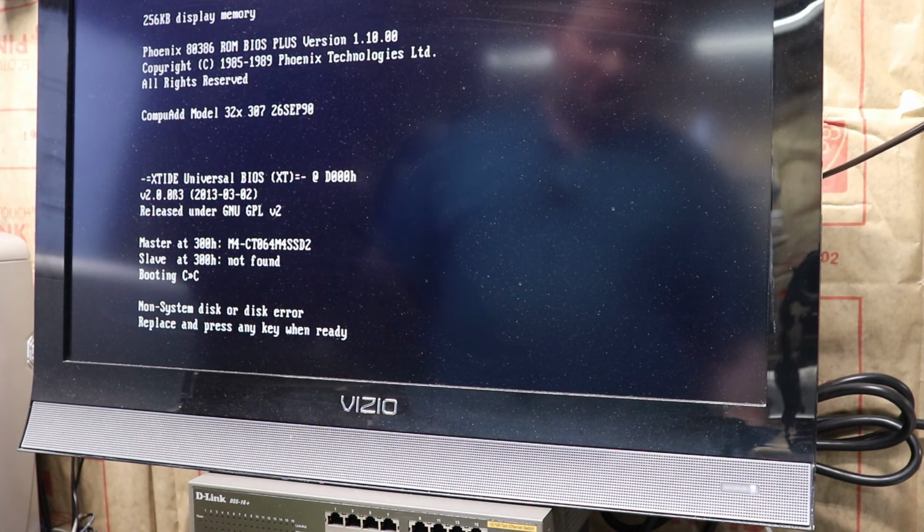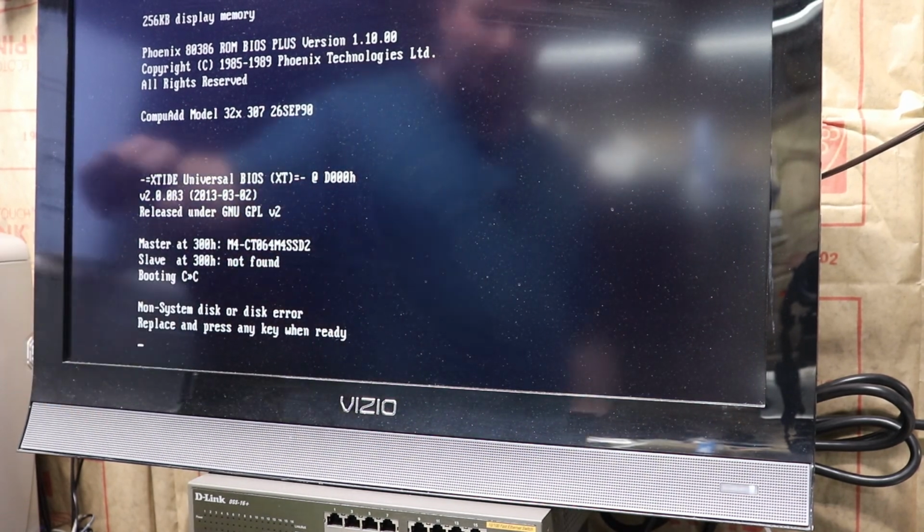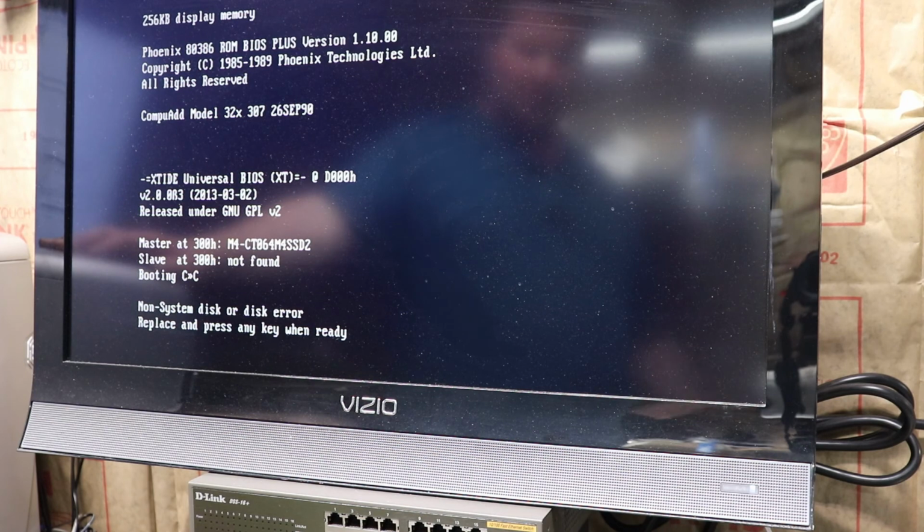But yeah, this particular XT IDE will not read an SSD. It will find it, as you can see right here, but it will let you install, well, supposedly install, get onto it, but the adapter and whatnot will not work. So that wraps up this, and I'll get ready for the next video.